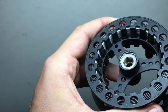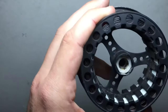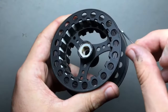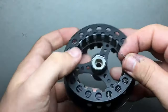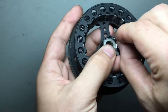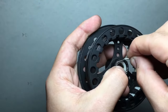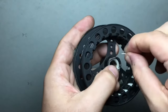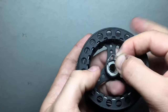As you can see there's a hexagon shaped gear in here trapped by a little wire piece. What you're going to do is remove that wire piece. Take something like a small nail or a little mini screwdriver and pry that little wire piece out. Be careful as you're doing this because if you don't hold down on one side of this little wire, it could go flying off and you're going to be trying to find a needle in a haystack.